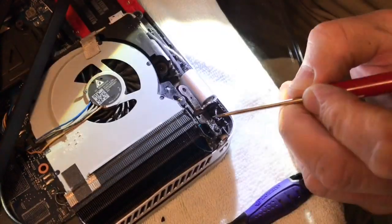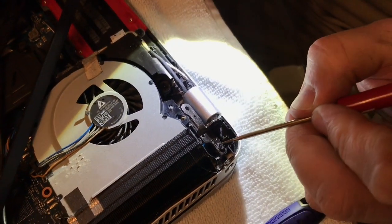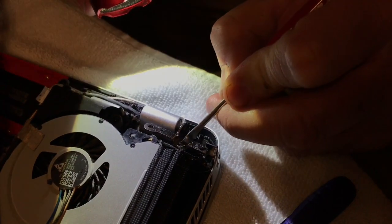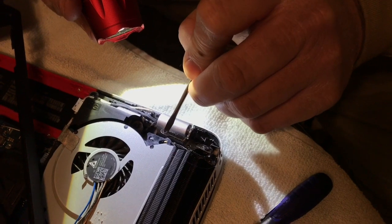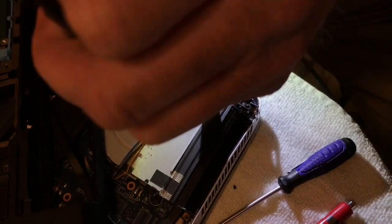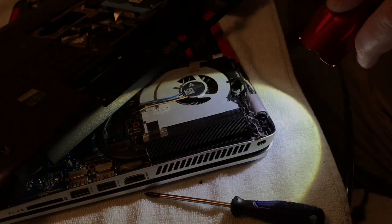One more thing before we put this back together — we started snapping the bottom back on and noticed this hinge was wedged up. This was probably the whole problem before, because my daughter said for a while it had a gap back here where something didn't fit right. What happened is the screw head here fits into a nutsert down in the plastic, and the nutsert came out — that's why this thing's all jacked up, and probably why it forced that other screw out into the fan. We're gonna take needle nose pliers and wiggle this hinge out, remove that nutsert, and do away with it. The hinge will be a little floppy but at least we can get the main body screw back in.